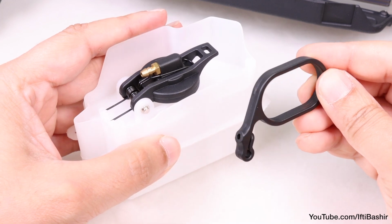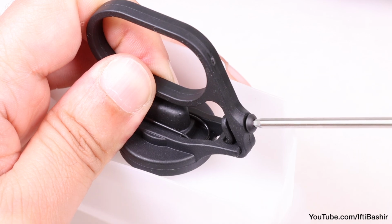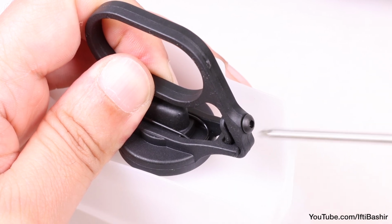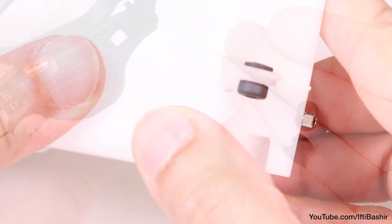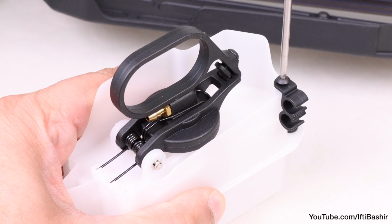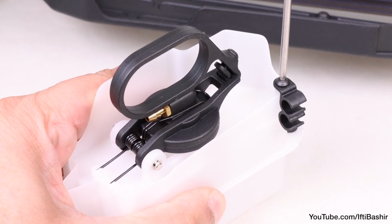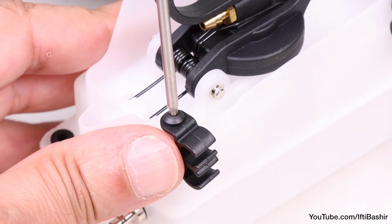Onto the fuel tank itself then, here we can clip on the pull handle and secure with a single 6mm buttonhead screw, before inserting a rubber grommet at either end, which can be a little fiddly, and finally use another two 6mm buttonhead screws to secure the two hooks onto either side, used to hold the fuel pipe that's run